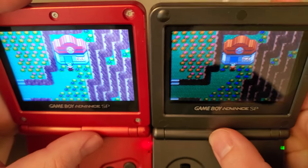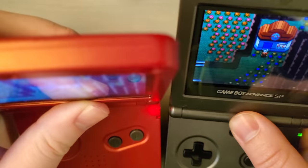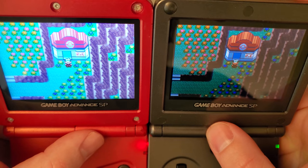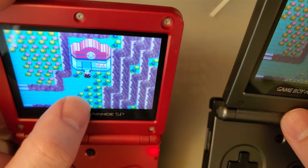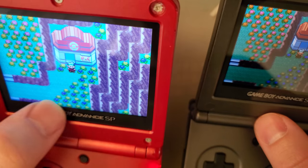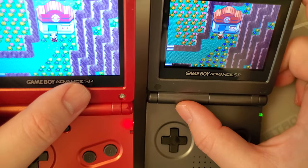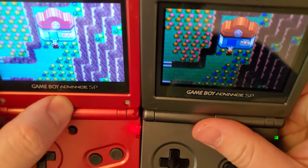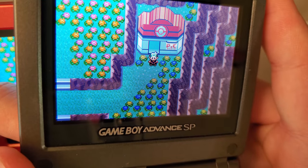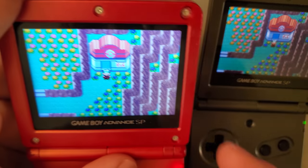The new screen is slightly bigger, and it's also closer to the lens — right up against it, as opposed to the AGS-101 which is spaced slightly behind it. It does look better. The laminated screens that newer kits ship with would be a step beyond that even. Cloud Game Store is one of the only sellers with quality reproduction lenses. And you don't have that pixel grid — the screen door effect that people get nostalgic about actually ruins the contrast of the LCD, and it looks so much better without it.